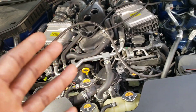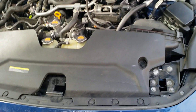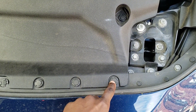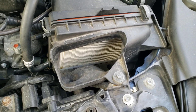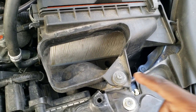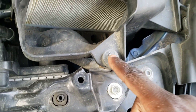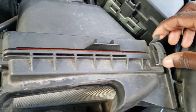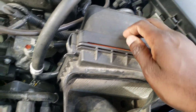I'm going to make this video pretty quick and try to make it specialized enough that anybody could do it. First thing is to get a flat head and take off all these plastic clips — stick it in there and this is going to remove the engine cover. Next, remove these two 10mm bolts to unclip and separate the front of the intake system from the back.